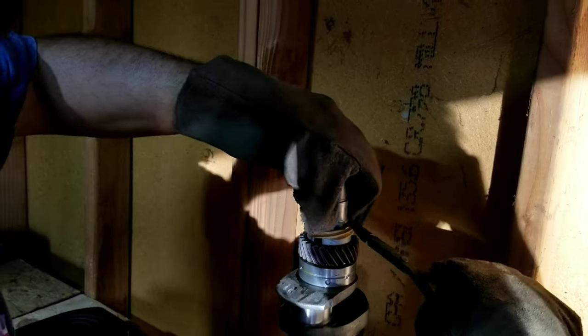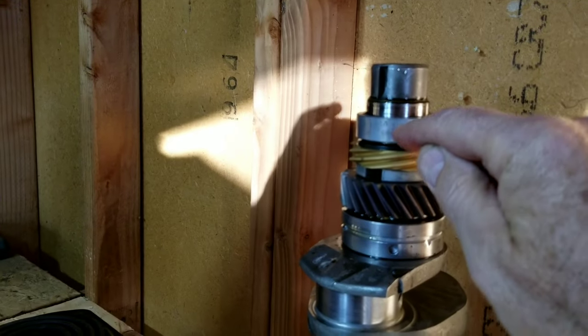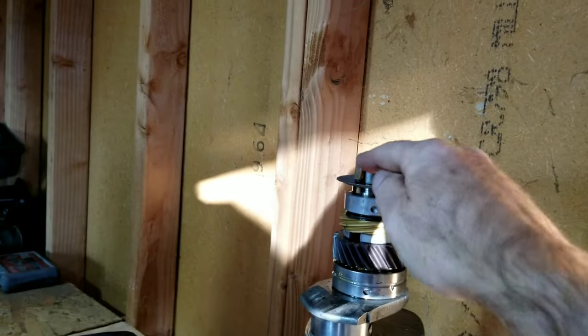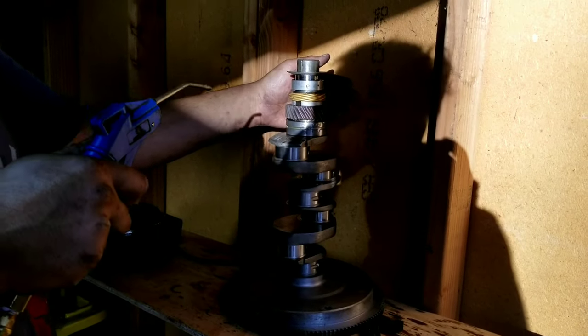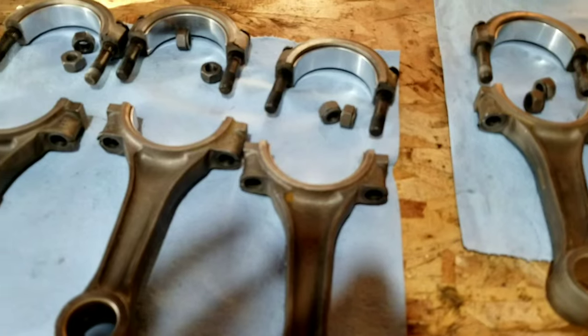We're gonna bring you guys, whoa, did it just slide right on? How about that? So again, this end bearing, this pin part, is gonna be down towards the crankshaft. Slinger and the key, slinger, key. And we usually set it, because let's pull this off with some air, you don't want to burn yourself. If you can just set it, sit there and cool off if you want.